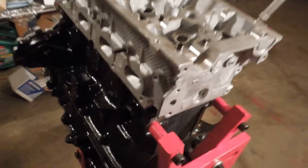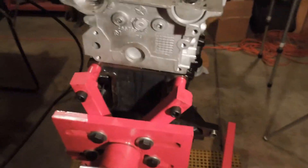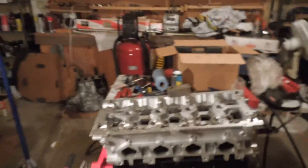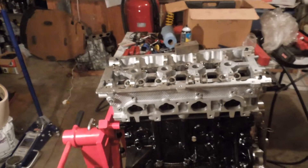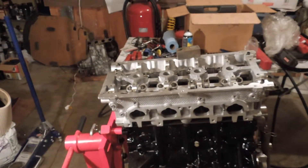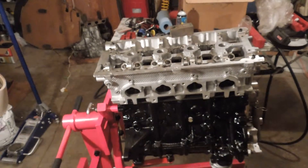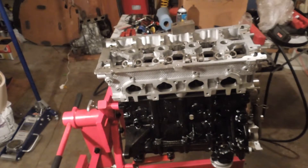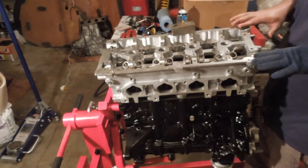I got a head gasket in between. I'm only going to snug these bolts up so I can take a measurement. I did put the putty back on cylinder two, and then I'll take the head back off. When you buy MLS gaskets or multi-layered steel gaskets, you want to buy two — always buy two — because you're going to want one in case the other one gets messed up in this process. I'm going to use this one for measurement, and the other one I'm going to put in for final assembly. When I do final assembly, I'm going to loctite the studs in so I know this won't come undone when the engine's running.